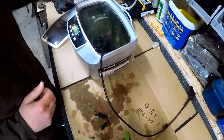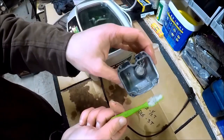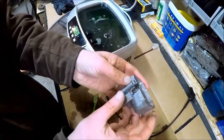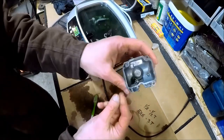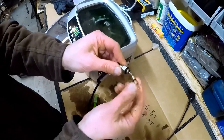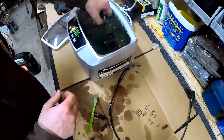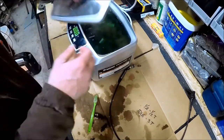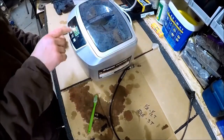Little update in the middle — full transparency — the float bowl needed a little extra help, so I got my wife's toothbrush in there and scrubbed it up. Starting to come out real nice. I did discover there was some gasket sealing down there and it's on there pretty good, so I'm going to have to scrape it off. Ran the choke assembly through — look how nice that looks, so that one's all done. Just going to let everything else keep going; floats are still good, give it one more stir, mix all your parts around.